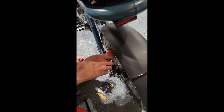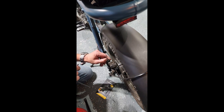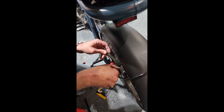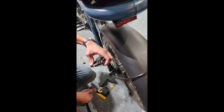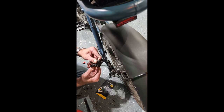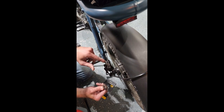In case you can't tell, this is my first time doing this particular job for a customer — that's not a cause for concern. Brake systems are pretty much the same across all vehicles. Go ahead and loosen the brake mount bolts. Once you get a couple turns in them you should be able to undo it the rest of the way by hand. Now that we've taken that safety pin out we can actually push the brakes straight out.